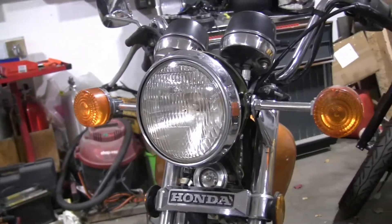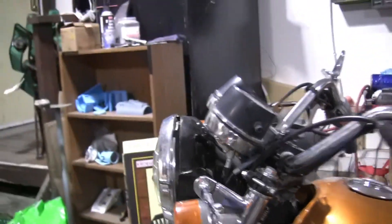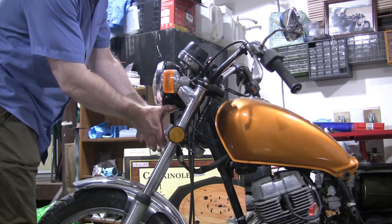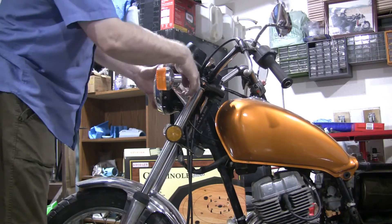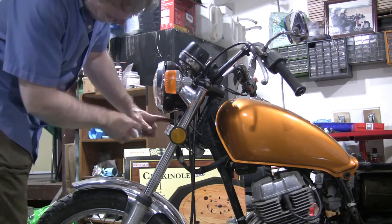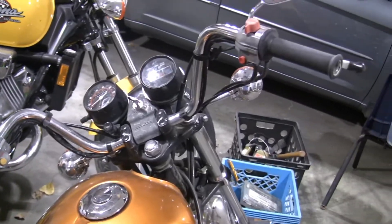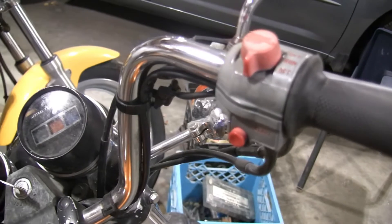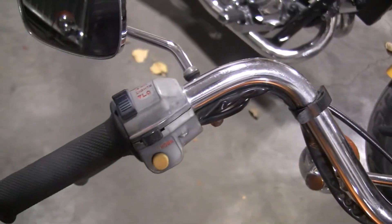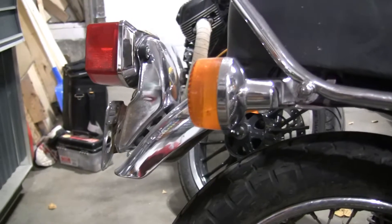We'll do new tires, new headlight — these single lights are not inspiring and this headlight's a little busted too. I want a headlight that is a little lower. This bracket is busted and will have to come right off; we'll have to weld on a new bracket and move things around. The signal lights have got to go. We'll definitely do something with these handlebars — they need to be revitalized, maybe get some different gauges, and we'll definitely do something with this seat. This fender will also have to be chopped.